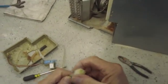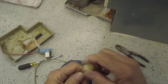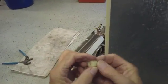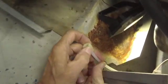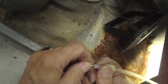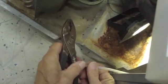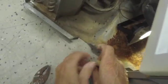First take out the sleeve right there, and then this plastic nut has a built-in ferrule so that when you tighten it, you take that off, you can see there's a built-in ferrule in there. So all you need to do is you take your piece of tubing, put it on like this, like that. You get your little brass sleeve here. I push that in there, it's kind of tight, but you need that in there. It helps keep the plastic nut tight so it doesn't leak.